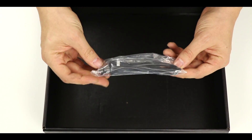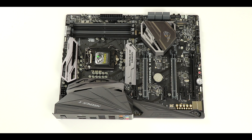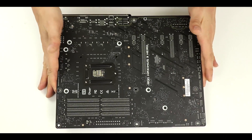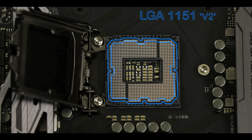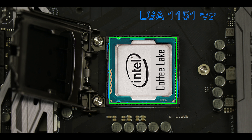Let's take a closer look at the motherboard. Starting with the obvious: this is an ATX form factor motherboard, measuring 30.5 cm long and 24.4 cm wide. It has no protective backplate, so be careful when handling it. It is powered by an LGA 1151 CPU socket — worth noting that even though it is the same LGA 1151 socket we had on both the Z170 and Z270 series, this motherboard is not compatible with Skylake or Kaby Lake processors. So far it can only support the new 8th-generation Intel processors, the so-called Coffee Lake CPUs.